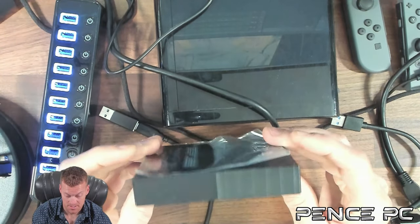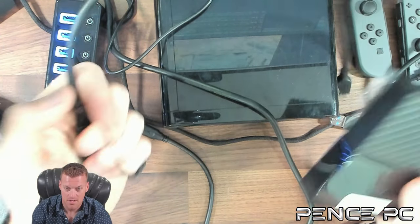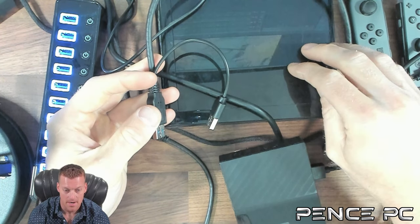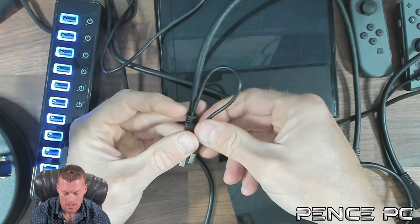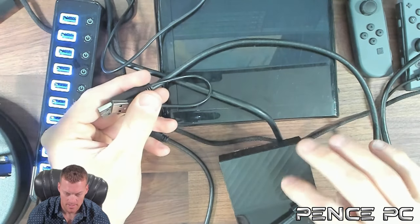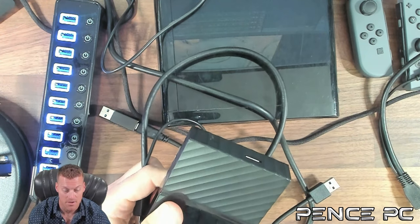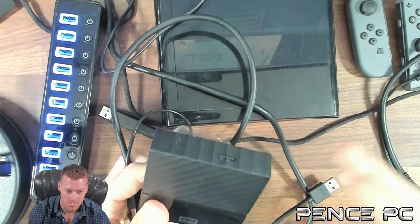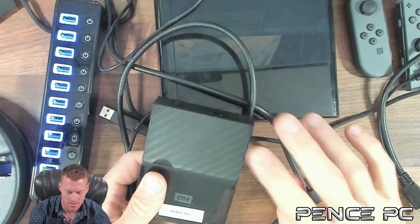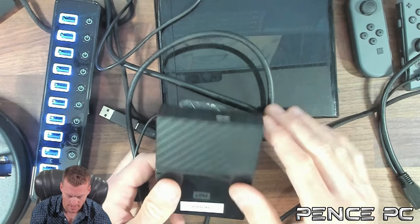For the most basic option, there's a standard external hard drive. If you use a USB-powered hard drive, you'll need a dual USB power cable because the Wii U doesn't provide enough power in its USB ports — both cables go into the back of the Wii U. Whenever you plug in a storage device to the Wii U, it will ask you to format it to a proprietary format, meaning only that Wii U can use it. You cannot format this hard drive and use it on another Wii U — it has to stay with this specific console.